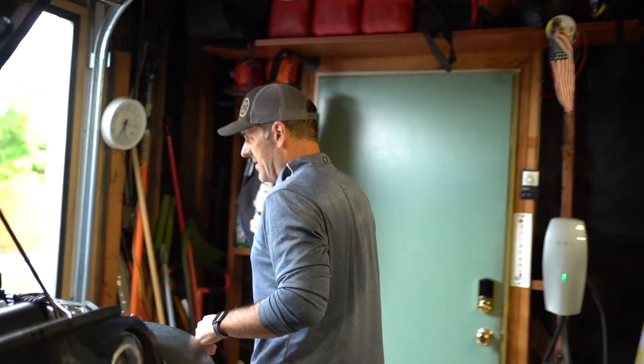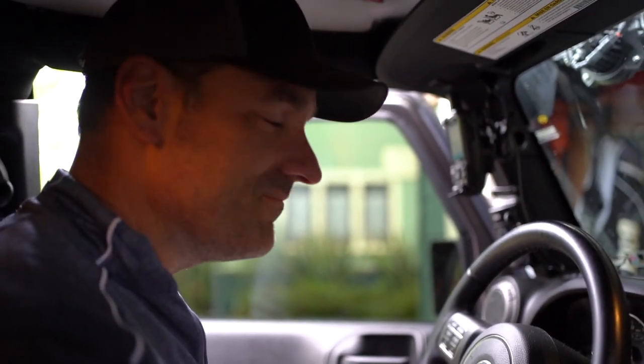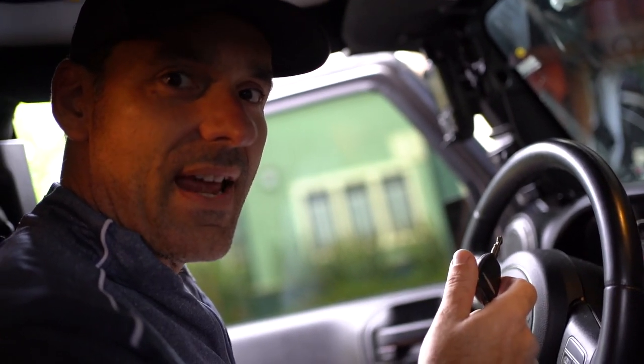You can put some tape, like on your door jamb, that says the mileage of your next oil change. Okay, so apparently you have your oil life setting that now needs to be reset. To reset the oil life remaining meter, all you gotta do is turn the ignition to the on position, press and release the gas pedal three times within 10 seconds of turning the ignition on, and it'll reset. Uno, dos, tres. Yeah, it's not that bad, is it?